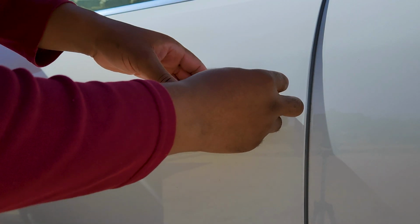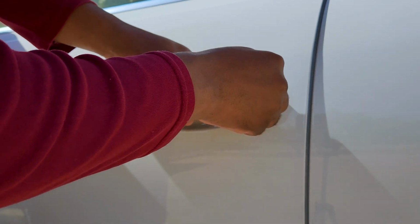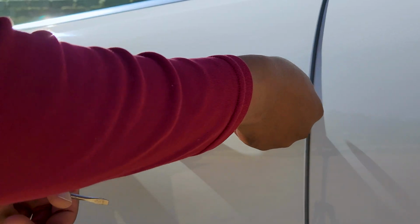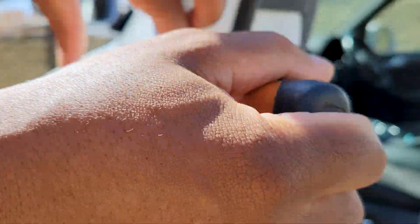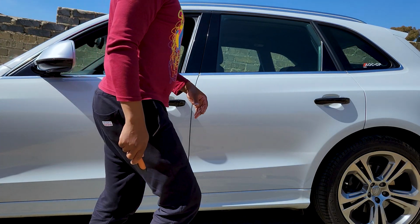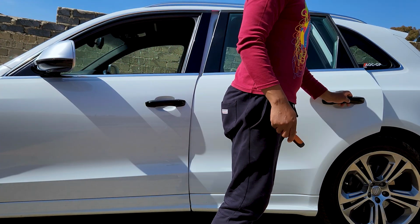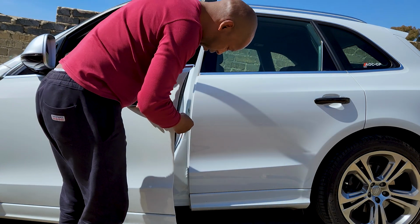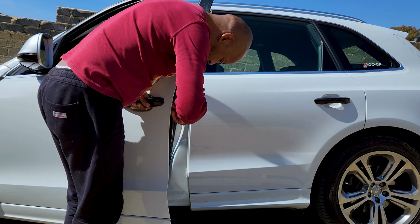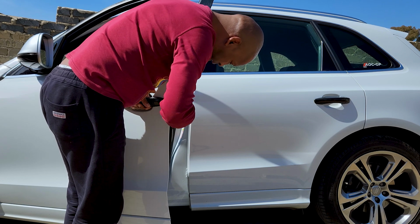And this goes on the other side. Go in to lock in place. And from there we tighten this T20 torx screw to hold this counterpart, and then I'm done. Both handles are done on the car, the rear one as well, same thing. This rubber goes in here at the back just to cover the T20 Torx.